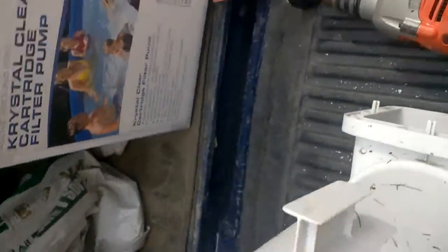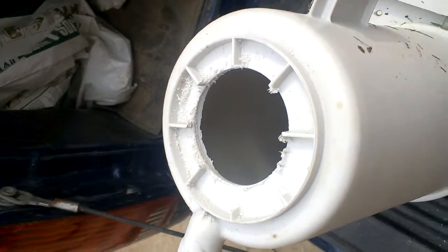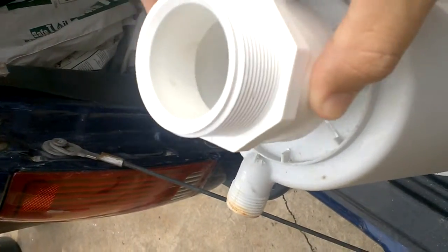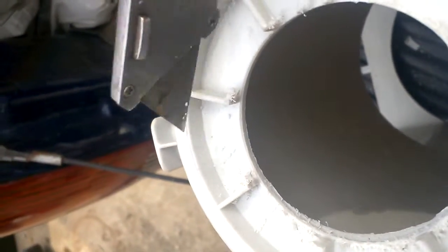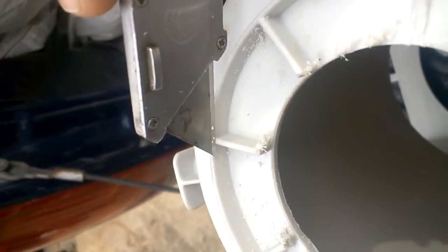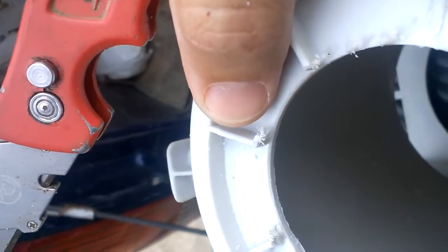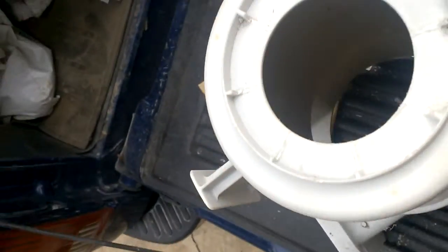First, I used a hole saw and very carefully cut the hole. Then I'm removing these ridges with my knife to get a good seat. On the other end, when this goes through on the inside, I'll lay in the silicone. All you need is a really sharp knife — you cut down toward the back all the way through, then score on each side at the crease and it'll pop right off. I've done that in a couple of places here.